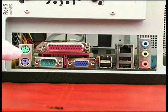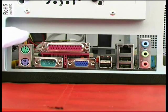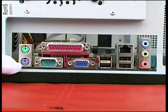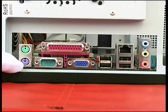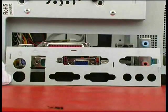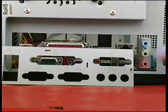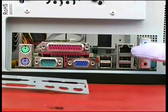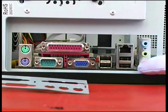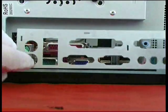Here we're looking at the IO ports at the back of our motherboard and you can see they're poking through the slot cut for them at the back of the system case. But you can see that in between the ports we just have gaps. We obviously can't leave the ports like this as this would interrupt the airflow within our system case and allow large amounts of dust to enter. So what we need is something sometimes referred to as an IO faceplate. Originally this system case did have a faceplate soldered to it which I've just snapped off, because the faceplate provided doesn't match up with the ports on our motherboard. You can see here our three holes arranged horizontally for sound connectors, whereas on our motherboard the sound connectors are arranged vertically. Next to them we have our RJ45 network connector and a couple of USB ports, but in that position we actually have a slot cut for a joystick connector. So that faceplate was no use.